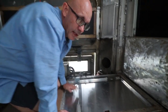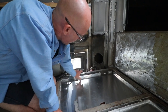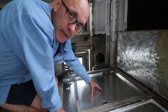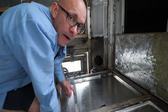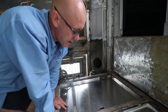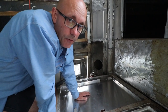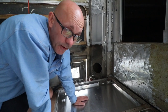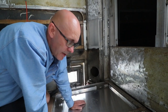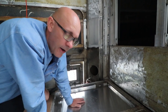We're putting aluminium in above the engine bay within the 50mm cavity of the box section steel. We put the aluminium in the bottom and seal it all the way around for waterproofing and smoke protection in case of fire in the engine. Then we fill the 50mm cavity with roofing insulation, which is fire retardant, so if there were ever a fire in the engine bay we'd have a much better chance of stopping it before it got into the motorhome.